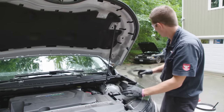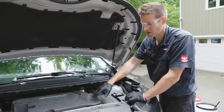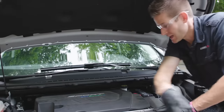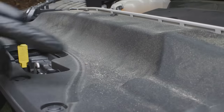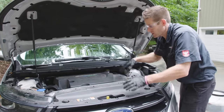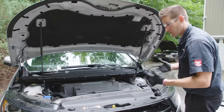In this particular car there's a lot of plastic so I don't need to cover much. But with an older engine like the Impala in the background, you'd want to put tinfoil or plastic on the alternator and any exposed electrical parts. Before you put water on, clean out any old leaves and junk in the edges — if you get them wet, they're a nightmare to clean out. Take a minute with your hand or a brush, or use compressed air. You don't need to clean the engine every single wash — the master guide suggests every two to three months.